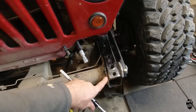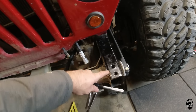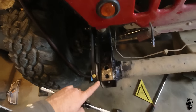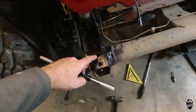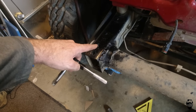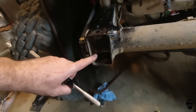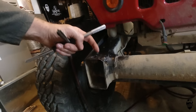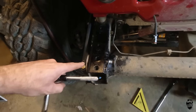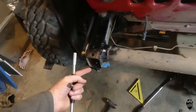With the bumper off, I took the opportunity to clean this up. I had to flatten it out a little bit, and I used my tap to clean all the threads out of all of these holes — three on this side and one on the bottom, and the same on the other side. I also had to flatten out the frame a little bit where it was bulging out and tap those threads. This middle one had the nut broken off and fallen out. I put a new nut on the inside and welded it to the frame — a new capture nut inside the frame. Now I have all six bolts on top and two bolts on the bottom all ready to go.